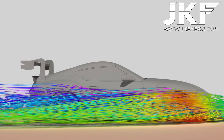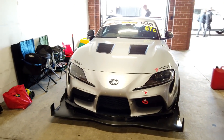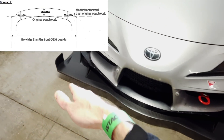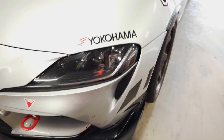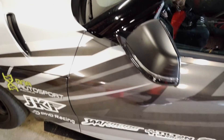At the front we're pushing the limits of what we can physically run in club sprint. We're basically using the maximum rule box out here — we have to follow the bumper at 50mm offset in front, and we're using that to the maximum. We've got a few little bits of detailing on the front splitter, some side tunnels going on here just trying to maximize extraction, and some little end plates at the front. There's also a lot of stuff going on underneath the car that we're not really going to show right now.